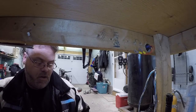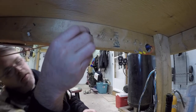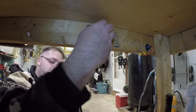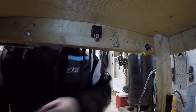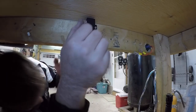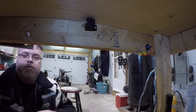So I'm thinking these are probably the input wires. I'm having a mind blank already, I just started for God's sake. We need to go into relay diagrammage on the phone. So — 85 is ground. We gotta put a connector on the ground. So we'll mount this up here somewhere — we'll screw the relay up in here.